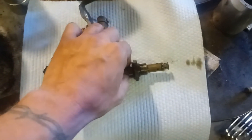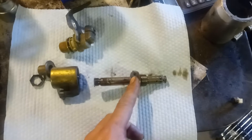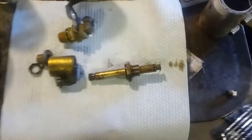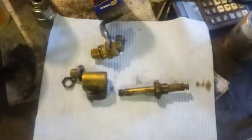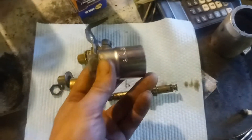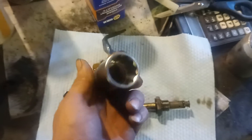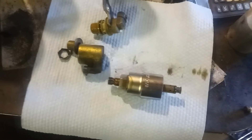You can also rebuild these — there's not much to them, just some O-rings and that type of thing. This is how they go together; you have to take them all apart when you put them in your motor. You need a special wrench or socket to get at it. I'm not going to spend money on an expensive wrench I'll use only a couple times, so what I do is get a socket that fits — this is a three-quarter inch drive — weld the nut to it, run it through, put a wrench on the end, and unscrew it. You're good to go.